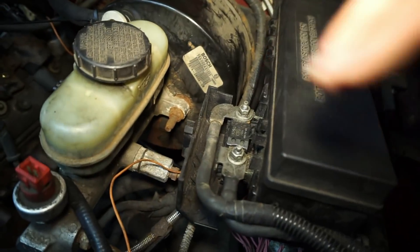Welcome back. As I said in the previous video, I'm working on that boost cut setup. I've done a bit more thinking and because my PCM relay is wired separately from my injector and ignition circuits, I think I'm just going to wire it to cut the PCM off. I do have one main relay going to the injector and ignition circuits, so there were concerns about cutting ignition while still dumping fuel and possibly hydro-locking the engine.